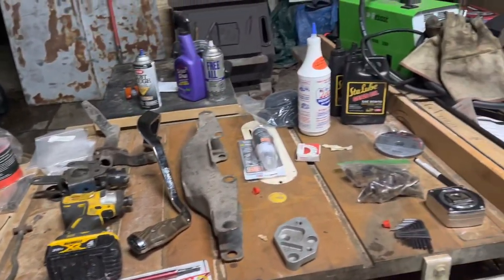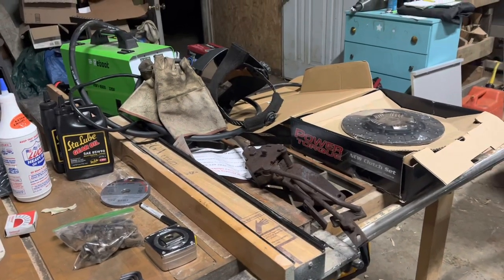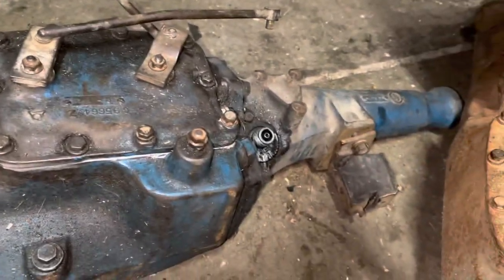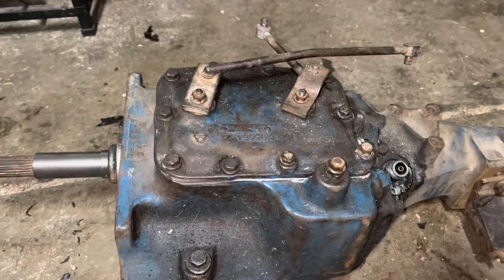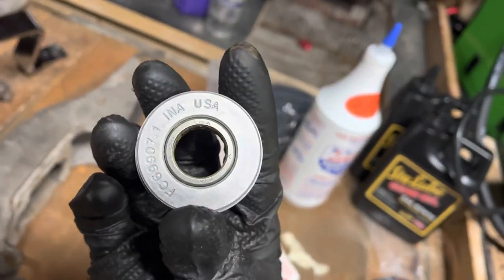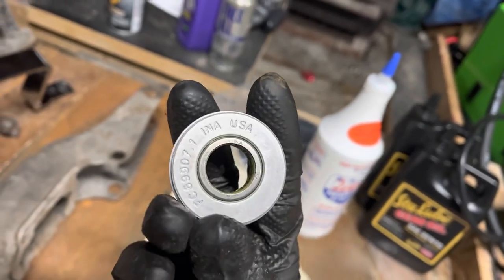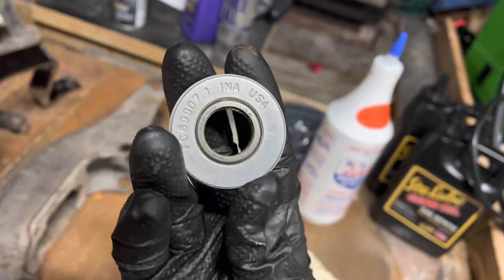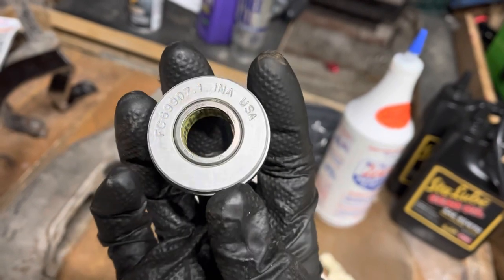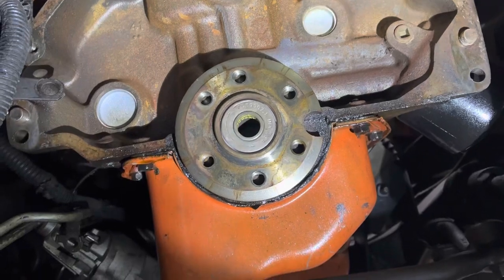I'm not 100% sure, but I am about 76.5% sure I've got everything in the building I need to at least make the car run and drive. Goop the heck out of that. Couple more bolts and I think it's ready to go in. Here's the pilot bearing I was talking about — notice it's in a spacer. Taps into the back of the crank, not into the old school pilot hole, which not all of these are drilled for as I understand. Costs about 17 bucks now, and I ordered it for a '97 Ram 1500, 5.9 gas, 5-speed. That's what it looks like installed.